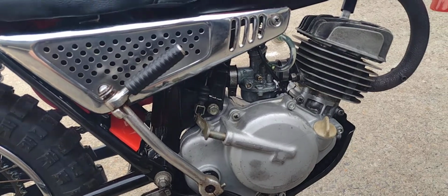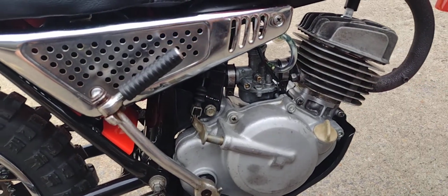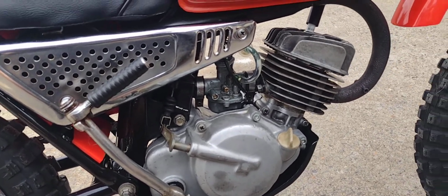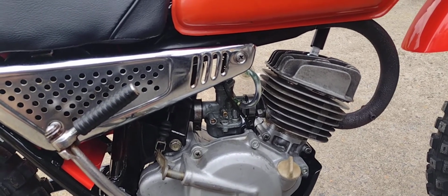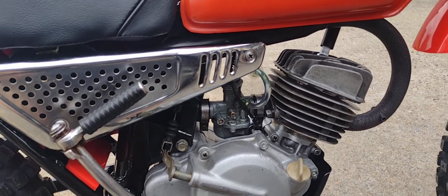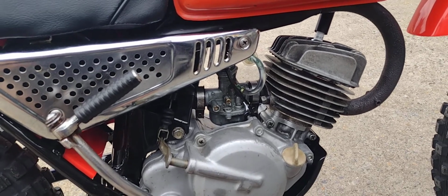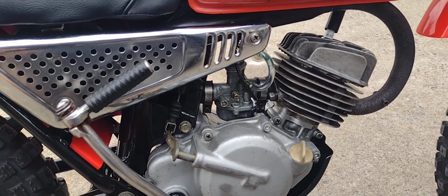We're making sure that as the cylinder and the piston heat up and they're expanding from the heat, we don't have any issues with the piston rings not getting along with all of the port edges and the exhaust bridge. So all that, after it was bored, the edges had to be chamfered so that we had good clearance on all that after this heat swelling happens.